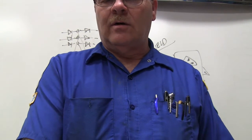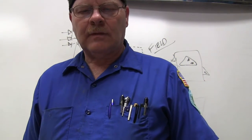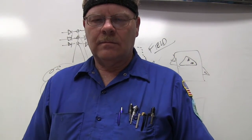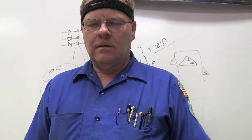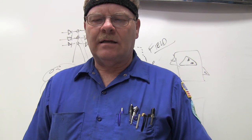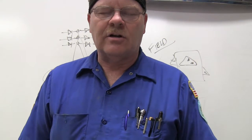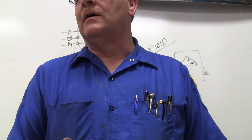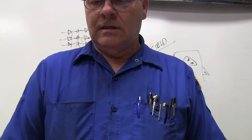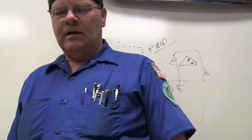Number 7, what is standalone regulated voltage control? It's acting in concert with the PCM and the BCM over the CAN bus. It uses a current sensor. You're going to see this on some of these newer cars. You know the little current sensor we put around the cable on the battery when we're hooking the charging system tester up? There's one of those built onto the vehicle. It's got multiple wires, and it controls the field wires connected to the voltage regulator and the alternator.